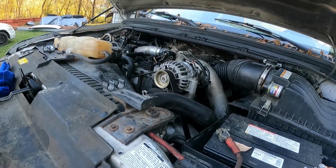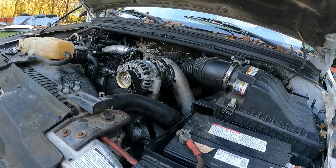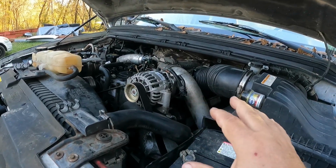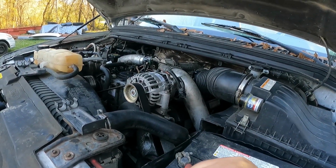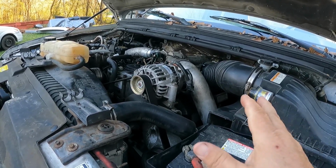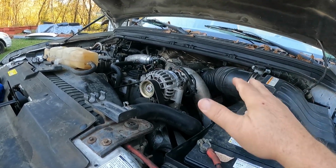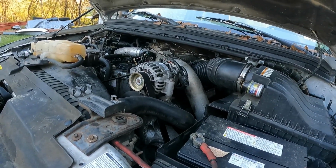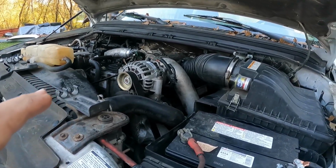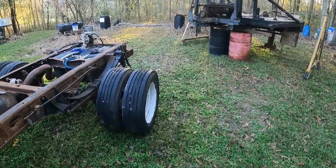And once you have that done, you can go back to putting on the valve cover harness, which we didn't put on yet. You can do that in whatever order you want. But that's why when I'm doing injectors, I'll pull the glow plugs first and they go back in last. That way it reminds me while they're out, I have to burp everything. So we went back in, we torqued all the glow plugs, put the valve covers back on, and got that done.